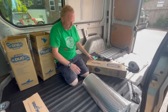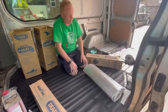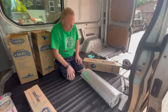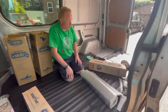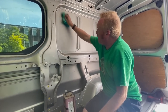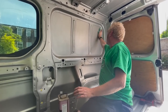What we've got here is Dodo Mat — you get this in smaller sheets for cars, but for camper vans you get a big roll. Just in case, warm it up — not that it needs much warming in this weather because it's hot. Get it placed wherever you can around the vehicle on the wall side. Cut it into sections and put it on as much of the van as possible — more the better. Just use a de-greaser or panel wipes to get some of the dust off and give it the best chance of sticking and staying up there.